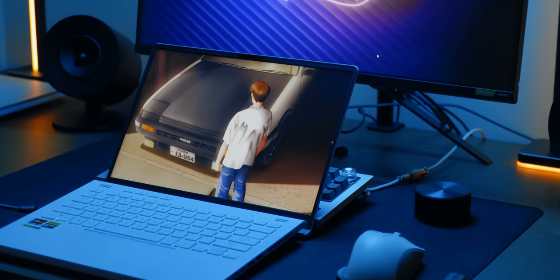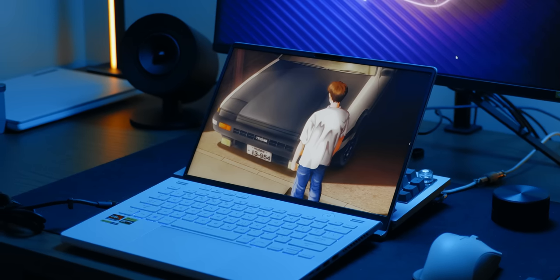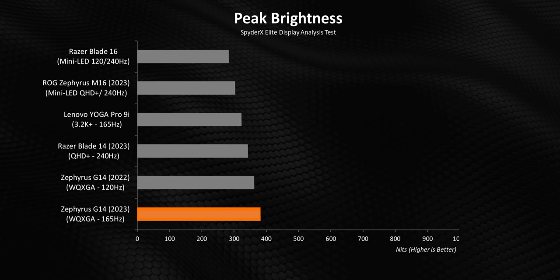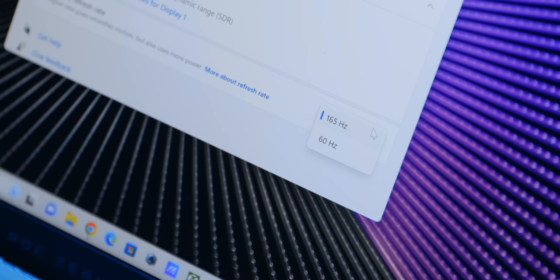The display has received some tasteful upgrades, like the shift to the new Nebula HDR panel which uses mini-LED technology to deliver significantly higher brightness and color output. However, my base spec still features the IPS-type display, which is an excellent panel offering great Adobe RGB and DCI-P3 coverage — identical to the 2022 model including brightness levels. You also get an upgrade from 120Hz to 165Hz, which is fantastic for gaming. For a 14-inch gaming laptop, this is probably one of the best displays alongside the Razer Blade 14.